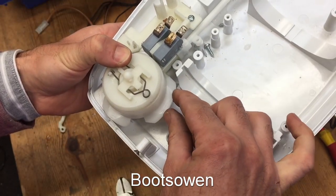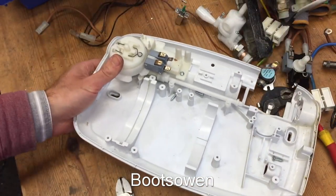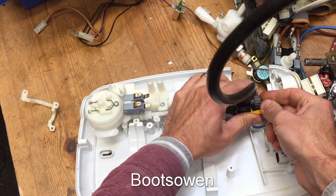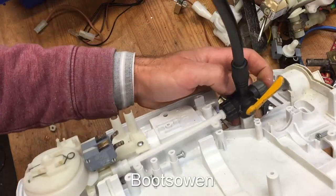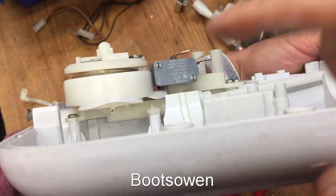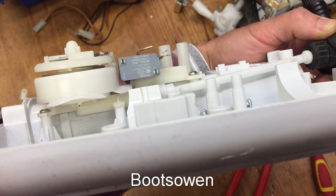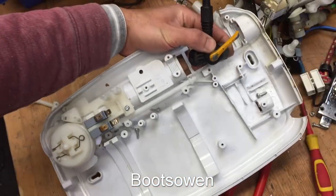These little ramps are wide enough to take two micro-switches for both elements, or one micro-switch for one element. But you can see at the moment they don't lift up. If I'm very careful and I get a bicycle pump up on the bench and put it over here — you know I'm making this look easy. And if the washing machine wasn't on in the background, you might be able to hear this clicking. Pay attention in here to this ramp — it works really well. That's just air pressure from a bicycle pump. You can see the whole switch moves up. So by turning on the solenoid you let that water pressure in and it turns the switch on. Really is pretty cool. You can hear the micro-switches clicking on and off.